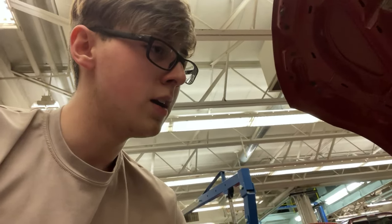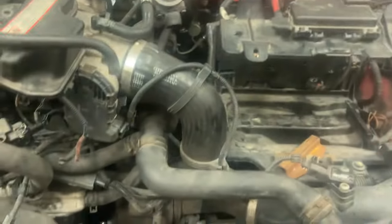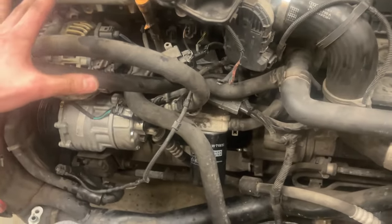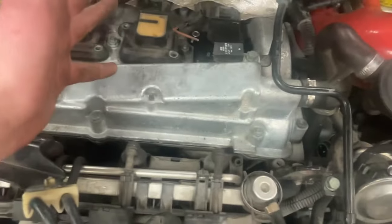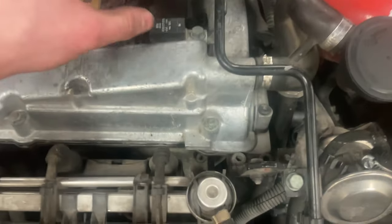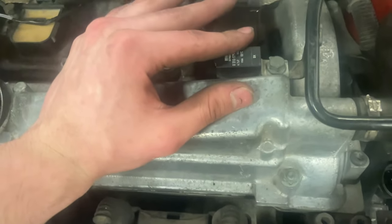There are no videos on this on YouTube, so I'm gonna be doing my best to give you guys a guide. It won't be perfect because I'm figuring this out too, but hopefully videotaping it will help me remember what I'm doing and not lose stuff. So after you've got your support, bumper off, headlights, battery out, you should have everything you see here. This is the N249 — you just take this off, you can find a guide for that, it's easy. This is for your radio — I broke that so I need to get a new one, don't do that.